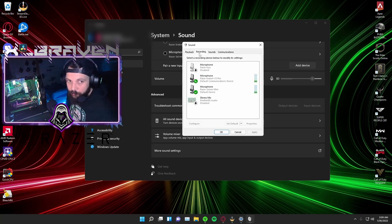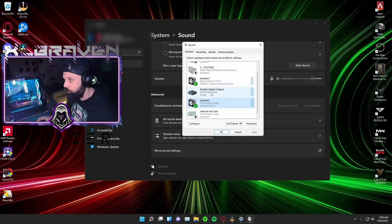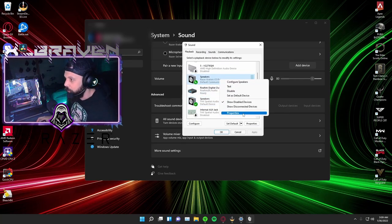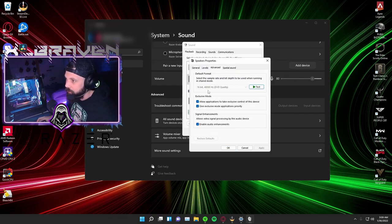I have two monitor audios disabled, and the THX Spatial Audio disabled here. Realtek Digital Output is the computer audio, so we keep that. You've got the Razer Kraken V3 Pro — you want that set to Default Communications Device, and then the THX Spatial Audio is your default device. Then go to Recording — for you guys it would be different. If you're using the headset microphone, just keep it as Default Device. Then check Audio Quality to make sure you're running at the highest quality. Go to Properties, then Advanced.